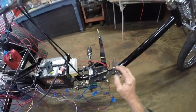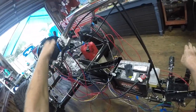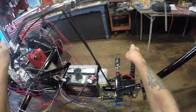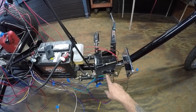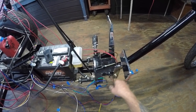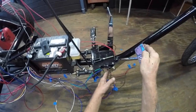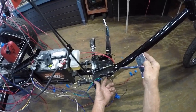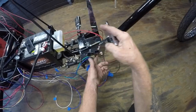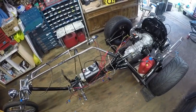I don't like that there's nothing to prevent the pedal from going too far — on this side you can push the slave right past the o-ring and it'll leak. I'm going to weld a bracket underneath here, masked off so I just touch up where I weld, and have an adjustable bolt with a locking nut to stop the travel. I can't judge the full stroke until the body's on, so I need to see if these hit the body or are clear of it.